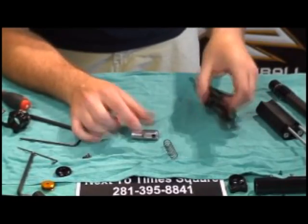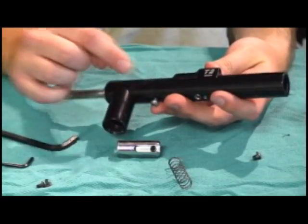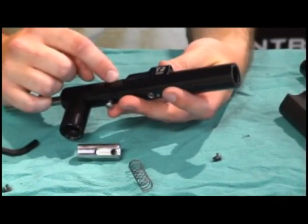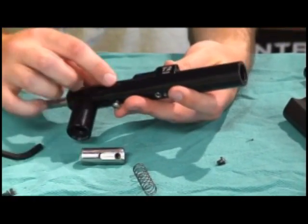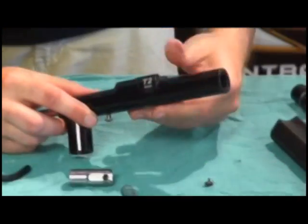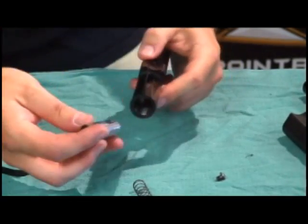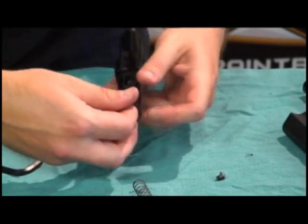Okay? Now, if we look at this bottom tube, there isn't much left to it. There is the valve still in there, and I'll have that link up. I'll put the link up again right now for how to tech that bottom valve. We don't need to do it because we've seen it before on other videos. Just wipe it down, clean that bottom tube out with a swab, again, some alcohol, and then we're going to put stuff back together. So I'll talk as I'm putting stuff back together.